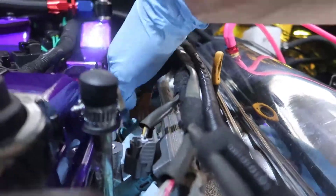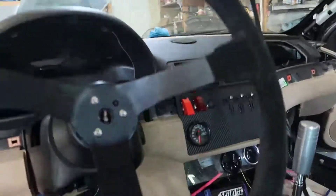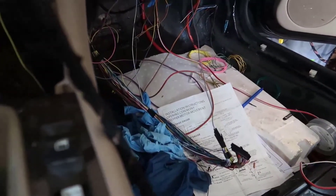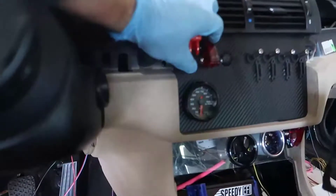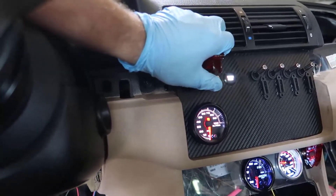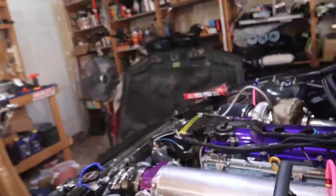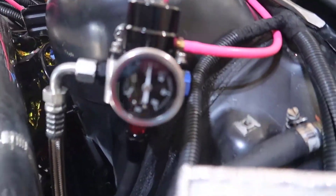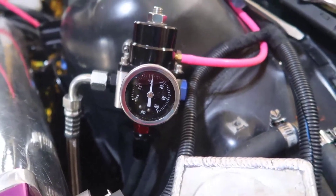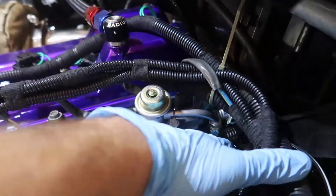Nothing leaked as you can see inside. The ECU has one plug - if I turn on main power and press this button it's going to try to crank. You can see it's happening... and check it out: 43, 42 psi and no gas anywhere.